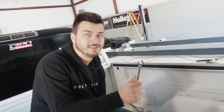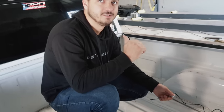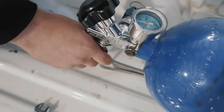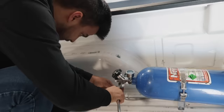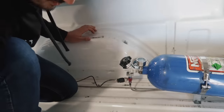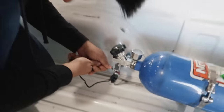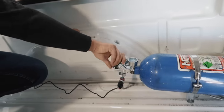Right now we should be able to turn the truck on, open the bottle, and get a pressure reading inside - but it's not that simple for us. Listen to this noise - oh we got a leak, a fat leak coming out of our pressure sensor. It's cold. Is there any Teflon on it? No. We should probably put Teflon on it. It's still leaking, so it's gotta go tighter. Now it's not leaking out of there, it's leaking up there - look at the liquid leaking out.